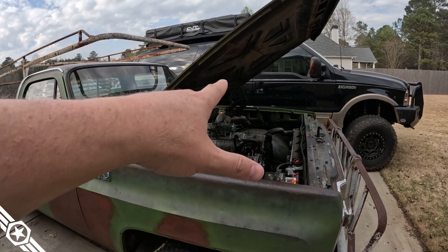The body lift will give us an extra inch between the motor and the hood. You're probably thinking the truck's going to be high in the front — that's probably true, it's already sitting a little bit high. So I bought a two-inch drop spring for the front. With the one-inch body lift and new body mounts raising us up about an inch and a quarter, the two-inch drop spring should bring us down to level or slightly low in the front, evening things out. A lot of headache to fit a blower under a hood without cutting it.